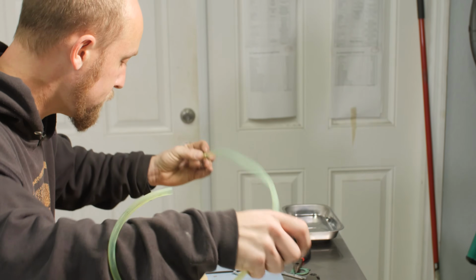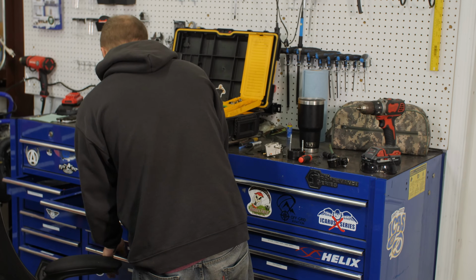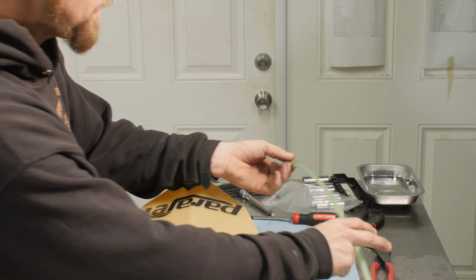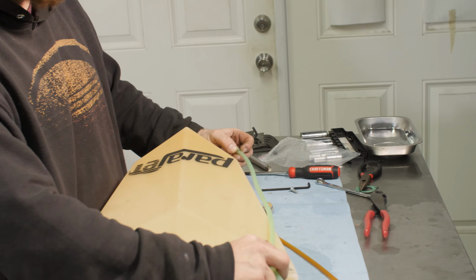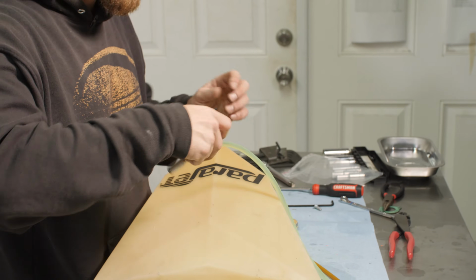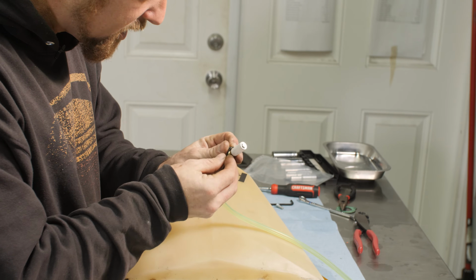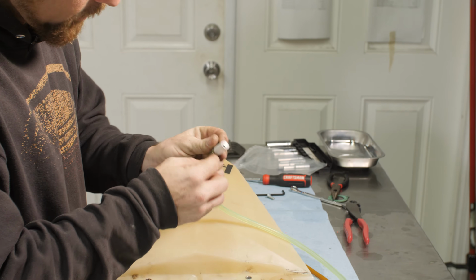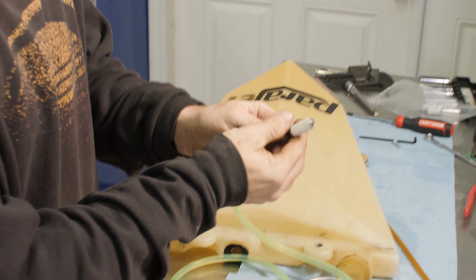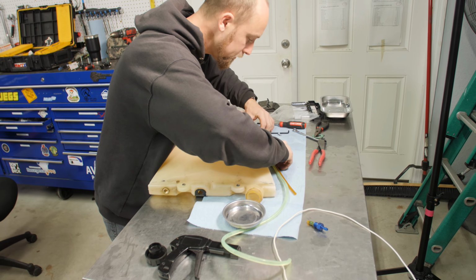Clunk generally stays submerged, so fuel leakage here isn't an enormous problem, but if you lose the clunk off the fuel line, let's say this clunk slipped out of here, it was sitting down in the bottom of the tank, and then your fuel line curls up like this, it's obviously not going to be sucking any fuel in. So you're more worried about it being secure on here than actually sealing. So we're going to double loop a zip tie. It's not going nowhere.